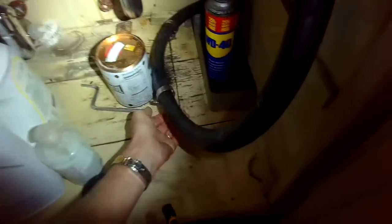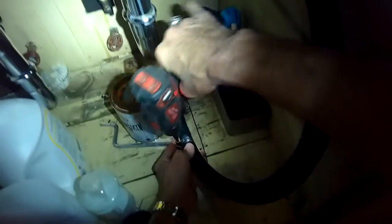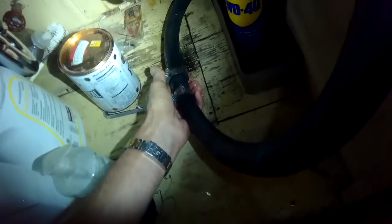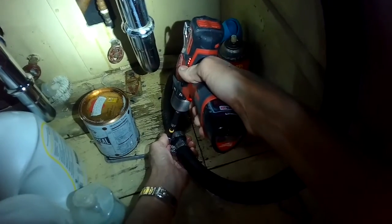When you have these drain tubes that come directly from the dishwasher and they don't go through an air gap up by the kitchen faucet, it's very important that you create a large upward arch with the drain tube, so that the top of the drain tube, at the top of its arch, goes a little higher than the garbage disposer itself. And that's so the dirty water will not flow into the garbage disposer from the sink and flow backwards into your dishwasher. Effectively, that's what an air gap does.